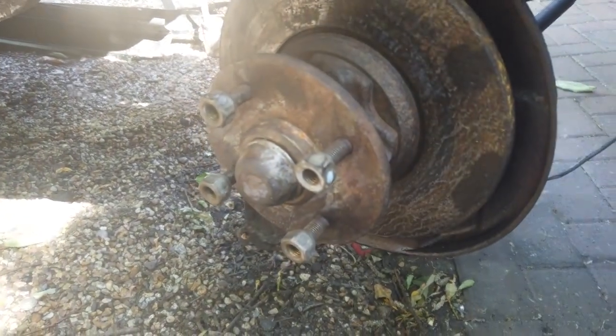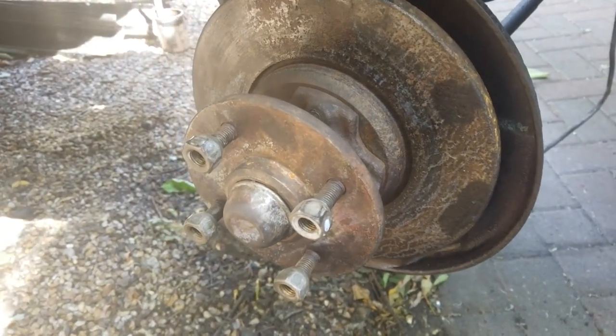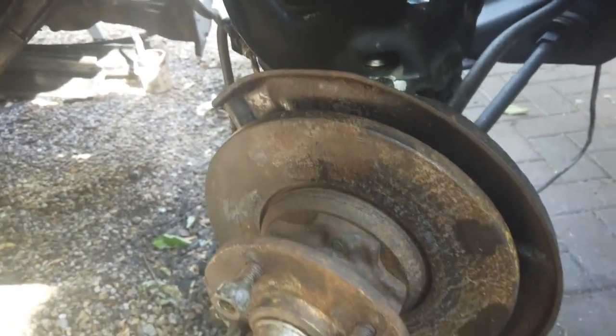Over this side we are short of flexi hose and I just have to finish a caliper off - reason being, trying to get one of the cylinders in, I'm not happy about one of the caliper seals I've ordered another one. It shaved a bit off when I was squashing it up - I don't trust it. I'm going to order another one so switch jobs, keep the time economical. Now I'm going to start looking at welding and the damage in the floor area.